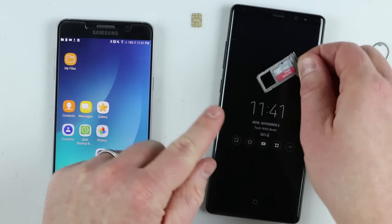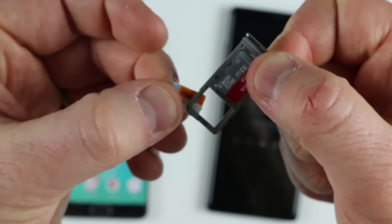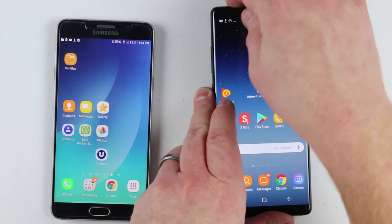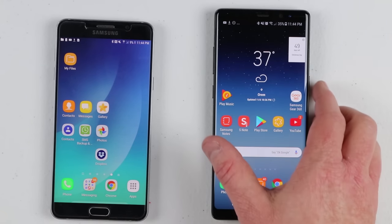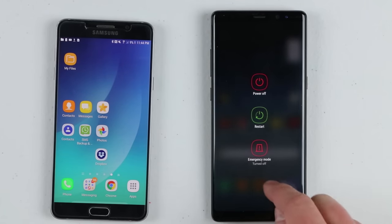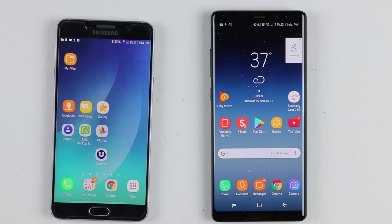On the newer Samsung phones, you have that slot for the SD card. And then the SIM card will just snap into the tray — make sure you have it aligned with the notch right there in the bottom corner. So then you take that and plug it in here. And sometimes it will ask you to reset the phone. I do recommend resetting the phone once you put it in the new device. All you need to do is hold down the power and then click reset, and that will just reset the phone real quick — turning off, turning back on — so that you have your data and your text messaging and phone calls all back on the new phone.